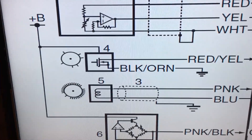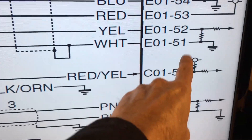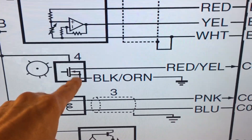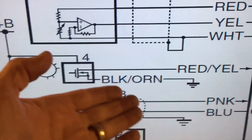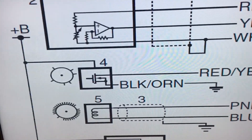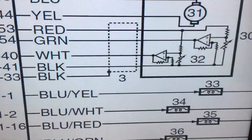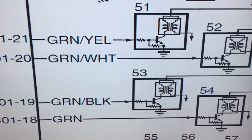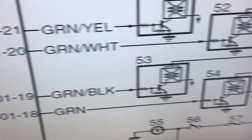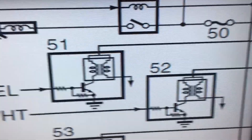Let me show you schematically what we're going to consider on the car. We'll look at the cam position sensor — item four — where that circular power supply symbol in the ECU represents a five volt line. Three wires on the sensor: ground, five volt signal output to the ECM, and 12 volt power supply. The other item is the coil-on-plug assembly — all four of them. Again, some of you may recall we have a five volt trigger coming from the ECU, a 12 volt power supply from the ignition line, and a ground — three wires on the coil-on-plug as well.